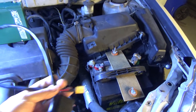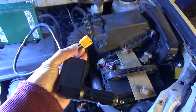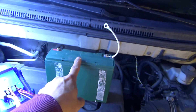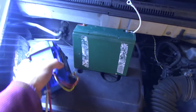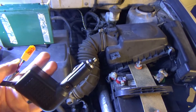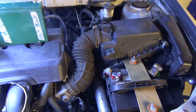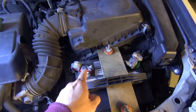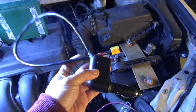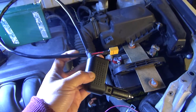Today I'm going to show you how to make this cigarette lighter cable and plug it into your cigarette lighter. At the other end, you plug in another 12-volt power source — like this battery here or my homemade 12-volt battery pack — to constantly provide power to your car so that your ECU does not reset itself when you disconnect the main battery cable.